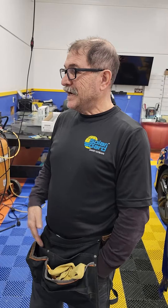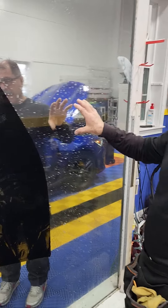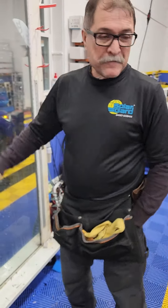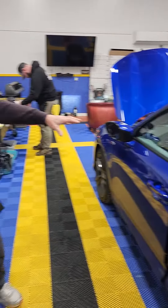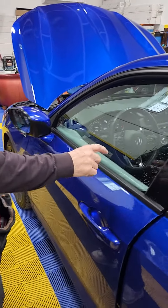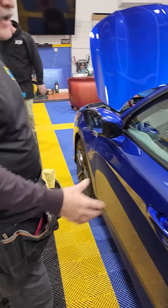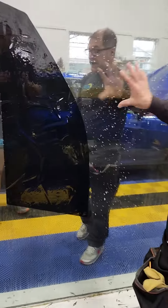I've been shrinking on the board for a while and I highly advise you to learn how to shrink on the board. Nothing wrong with shrinking on the car, but things can go wrong — you could burn the film, there could be contamination that transfers to the film. So there are a bunch of reasons I prefer to shrink on the board, and it's very simple.